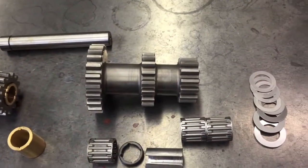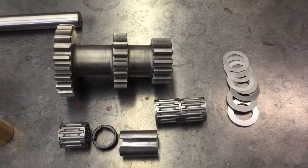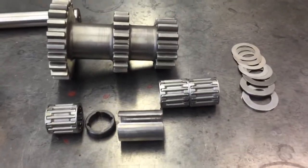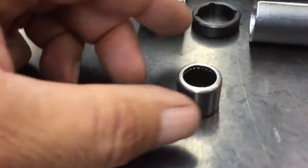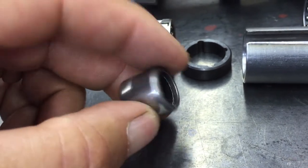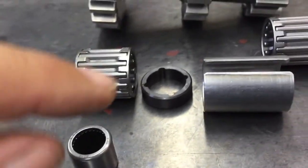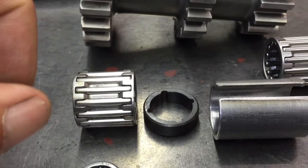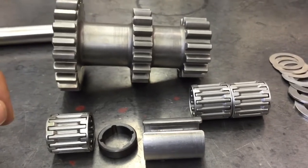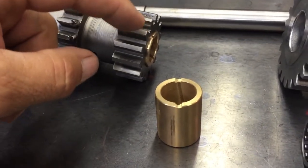This is our roller bearing upgrade — it's not a needle bearing, it's a roller bearing, which is far higher loading than the B-series needle bearing. Needle bearings have a casing around them and are called needles because these are very small and don't take much loading. This roller bearing setup we came up with a long time ago, and we tested this out extensively on sidecars, because sidecars are really, really hard on bushings — they just start tearing this setup apart. This end here is extremely heavily loaded.